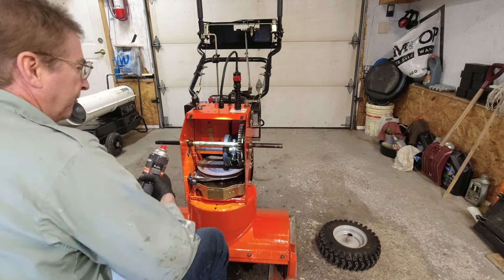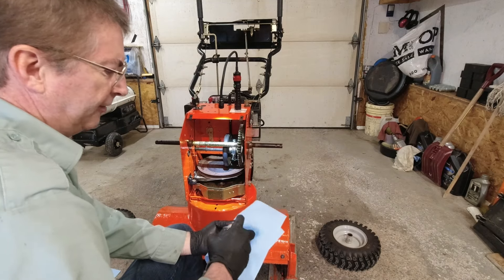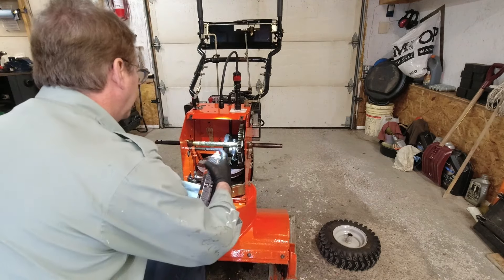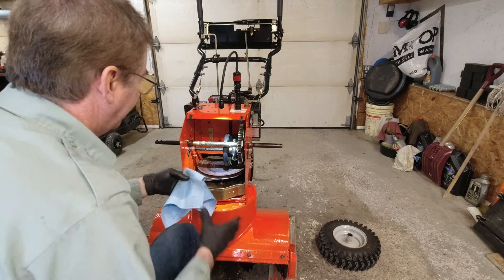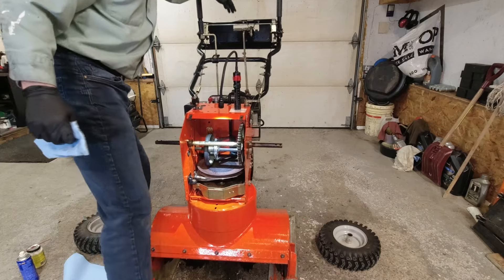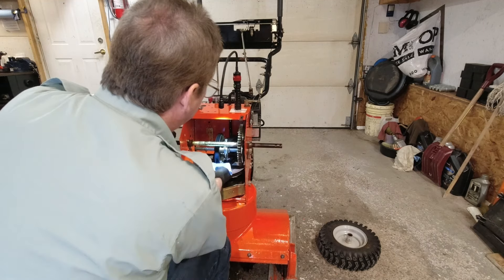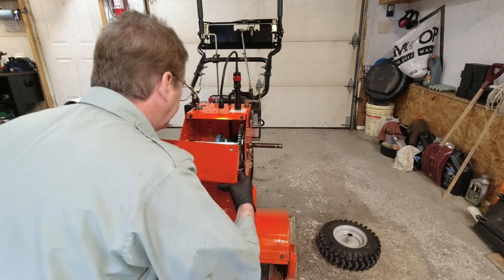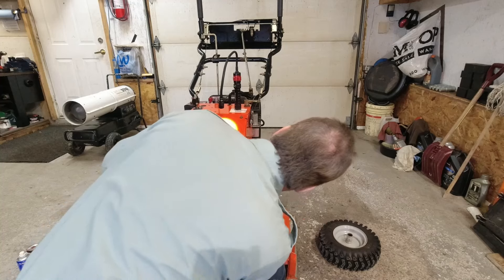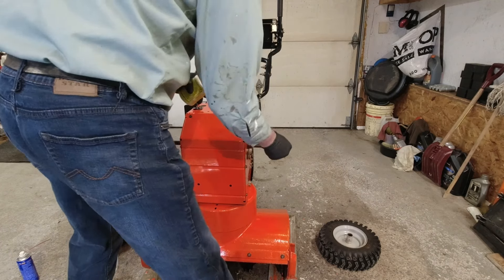Now I'm going to clean the oil and grease off the drive wheel and we'll call it a day in here and put the cover back on. We've got to clean this wheel — if not, when you try to move forward or reverse it won't work. Now get that gear on the other side. Okay, we're good — I'm just going to put the cover back on. I already put anti-seize on all these bolts so in the future they don't seize. Anti-seize on the shaft is important.